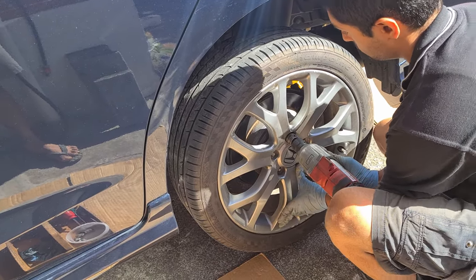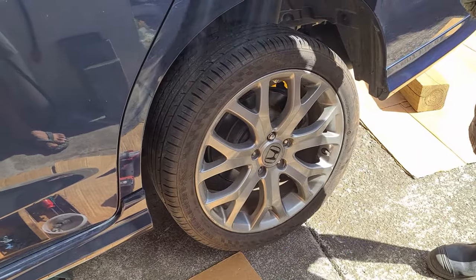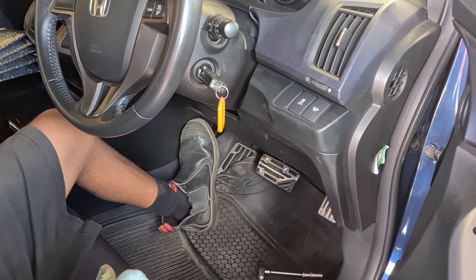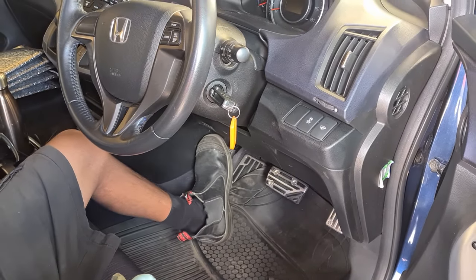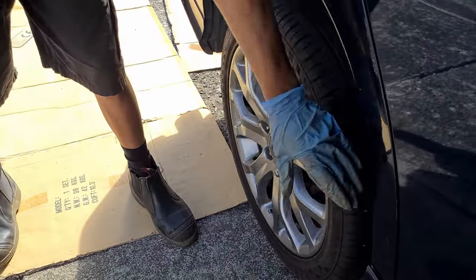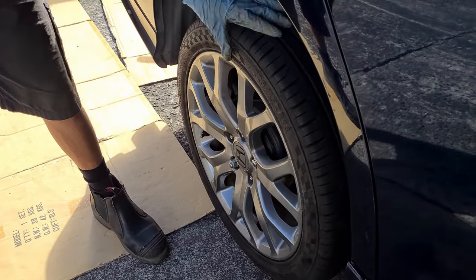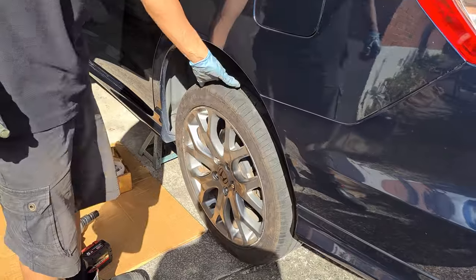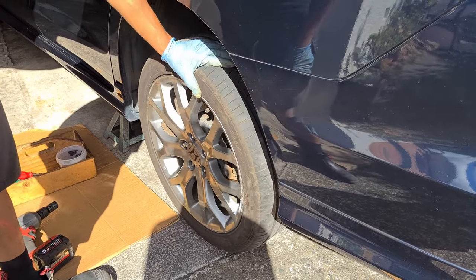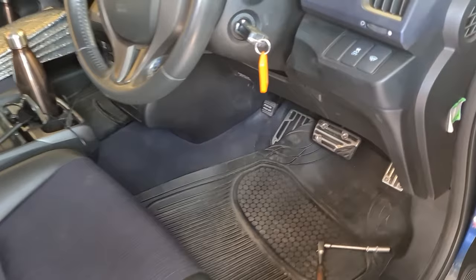Now I've put the wheels back on temporarily. We'll press the foot brake down by one click. This side doesn't have much drag — it's quite free. On the passenger side, turning the wheel either way it's nice and free with no drag. So we'll go inside and adjust the foot brake cable as initially described.